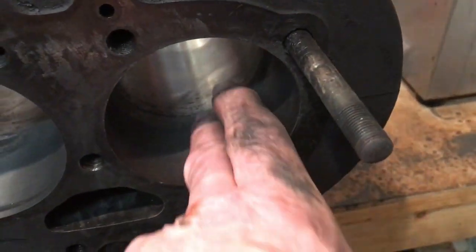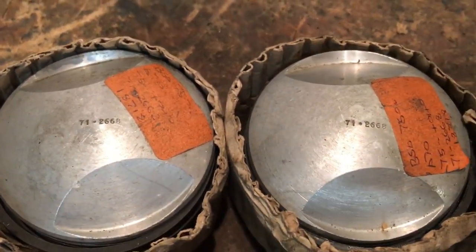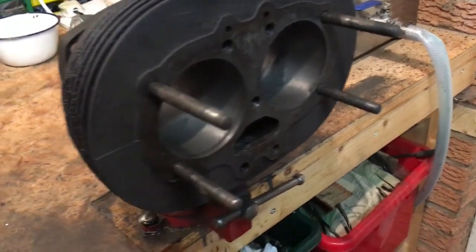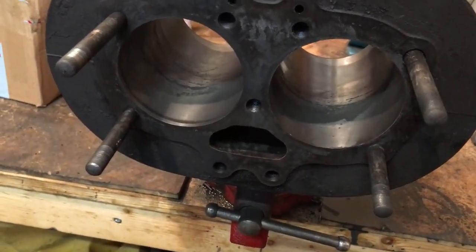Lots more honing and cleaning, and you can still see the scars. So no to worry - we'll go back to Plan A and get these bored out to plus-40. There are the plus-40 A70 pistons, part number 712668; standards are 712666 - those are for the other barrels that are having liners. So we'll leave it there while we make arrangements to have these bored. The barrels are in good condition, need a bit more cleaning up, all the fins are there, don't appear to be any cracks - but we'll get that tested. They weren't a great deal of money so they're a good buy.